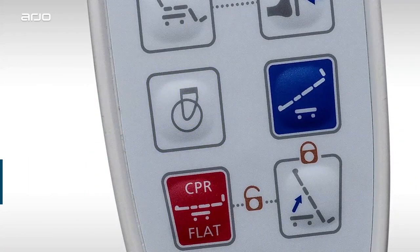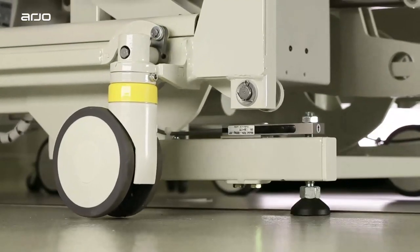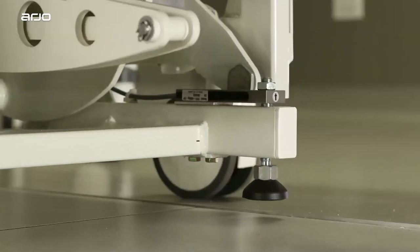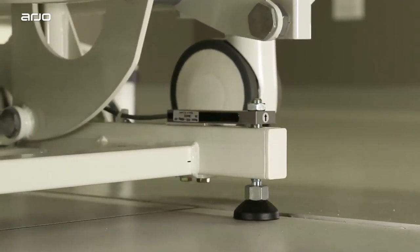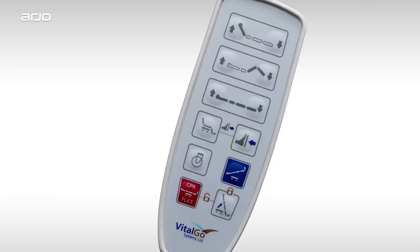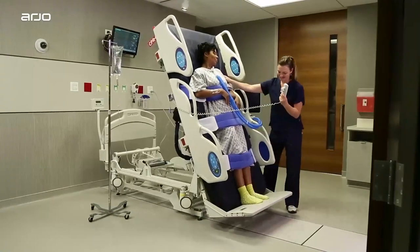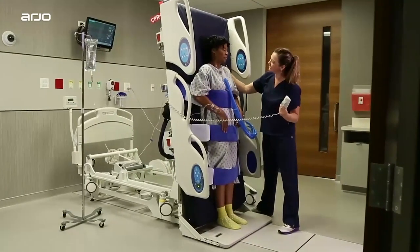Press the casters button to lower them. Always make sure you listen for two beeps when raising and lowering the casters to confirm the action is complete before proceeding to other functions. Press the CPR or the raise bed height button to disengage the casters and place the bed on its feet. The casters will disengage so the bed can remain in a stationary position. Those are the controls of the wired hand pendant, a handy and convenient feature of the Total Lift Bed. For complete instructions, please refer to the Total Lift Bed instruction manual.